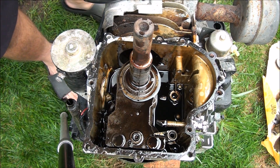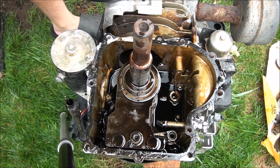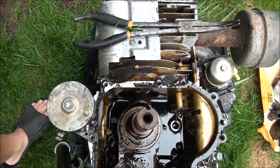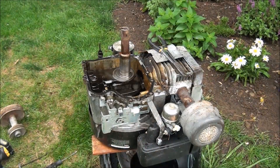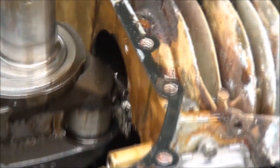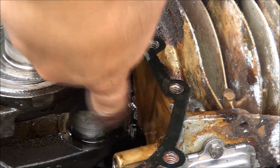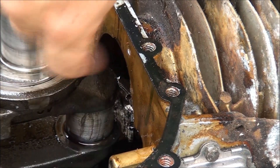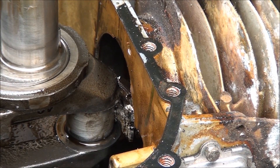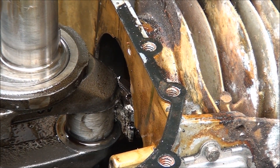Still haven't found what let loose. Yikes — that rod broke. See it up in there? Busted. You can see the broken rod there. And unfortunately, where the rod rides on the crankshaft, I can actually feel grooves in it. That's not good. That's also supposed to be glossy and smooth with no marks. So I think this crankshaft is probably ruined too. Not sure if I'll be able to clean that up.